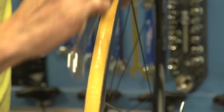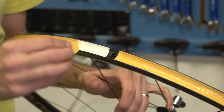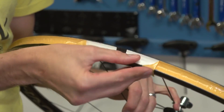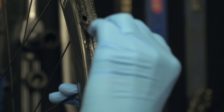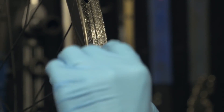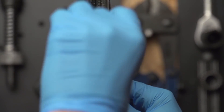Then I go through the whole process of fitting the tubular tyre to the rim — we've got a video in the description below. Tubular glue, well, the name gives it away — it's a glue specific for tyres and rims. There are different methods; some people don't like to apply too many layers, whereas others like to apply lots. Cyclocross riders put on quite a lot of glue because they don't want the tyre to dislodge from the rim, as they're using a lot less tyre pressure.